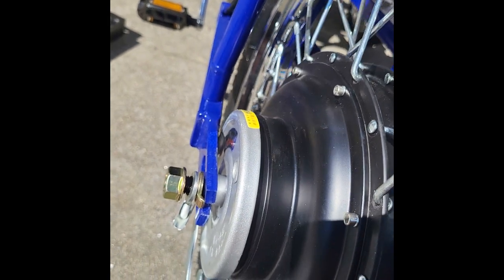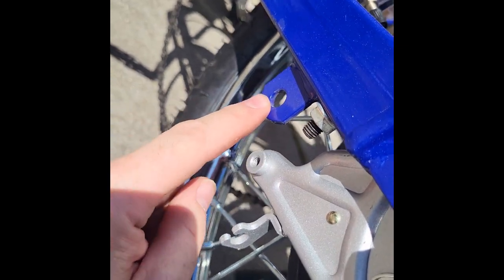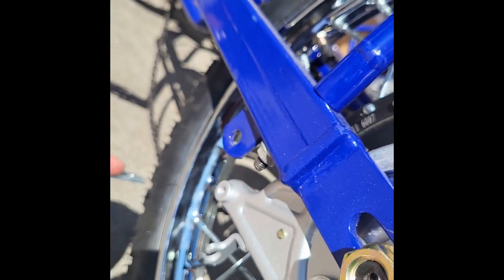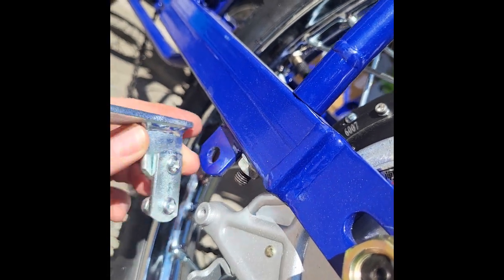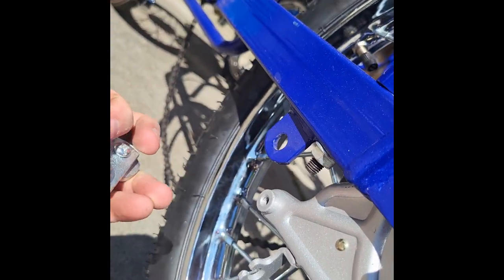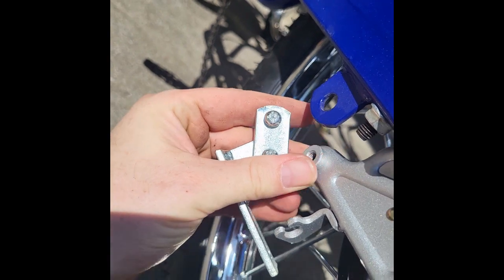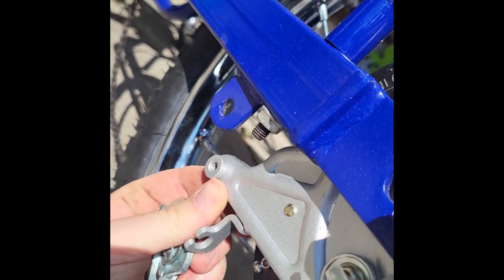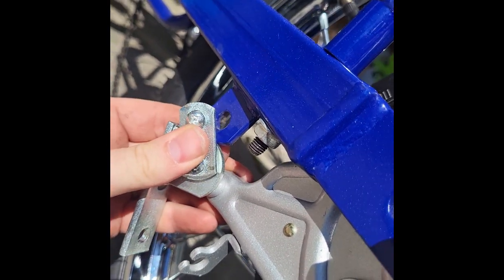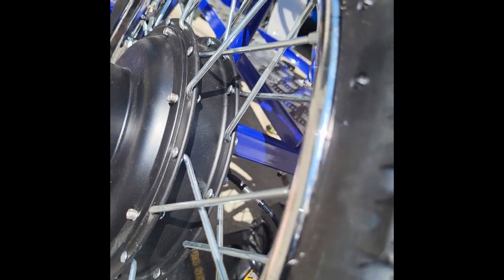This side does touch a little bit — that's your brake, and this piece is not going to move. Your tire spins in here, but the brake hub will be attached to the frame. If you don't have a tab on the frame, you can bolt the included metal piece into place. The little metal tab gives adjustment room whether it needs to go left, right, up, or down, and it can rotate around to fit. Once you get your wheel in the right spot, attach the brake hub — this is what locks the brake in place and keeps the hub from spinning when you apply the brake.